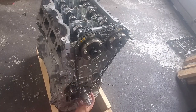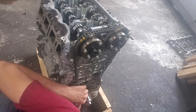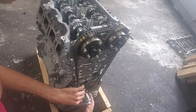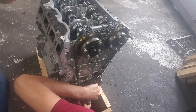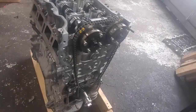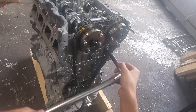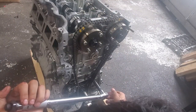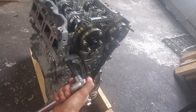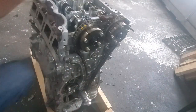Any pin will do — I used a small allen key. After both timing marks are roughly facing upwards, I lay the timing chain on top and align the marks. I then try to line up the red dot on the bottom of the chain with the factory mark on the crankshaft, which is marked with a small dot. I had to spin the engine a bit to get it to line up. Next is the right side timing guide — you may need to spin the cams a little to add slack to the right side. After, install the left side guide. You can leave the top guide to later. Torque everything to spec after verifying the timing and install the top guide with one bolt.